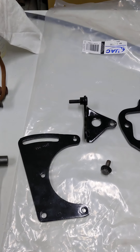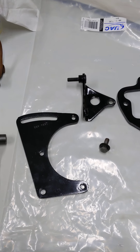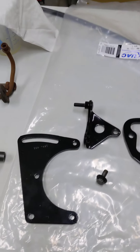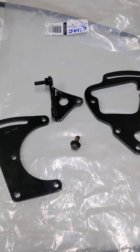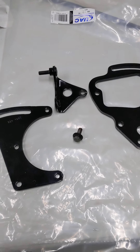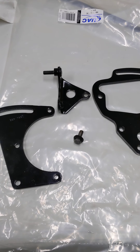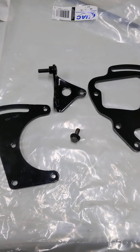Another good reason to take a picture of everything when it's together, so you can see how all the brackets go — because sometimes they're not easy to just look at and figure out. Basically, that's what you need to do to replace the compressor: take it off, take the brackets off, get your new or rebuilt one, put the brackets back on, install it back in place. Take out whatever oil is in the compressor, measure it, and then add that correct amount to the new compressor.